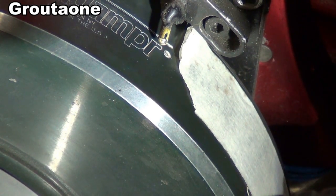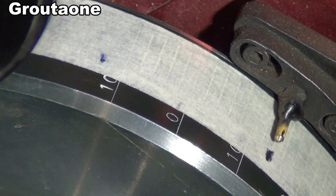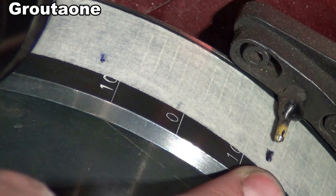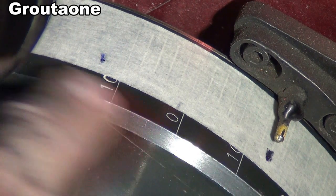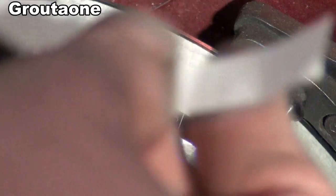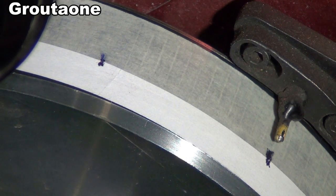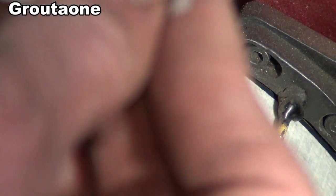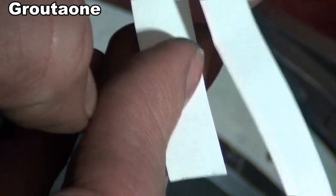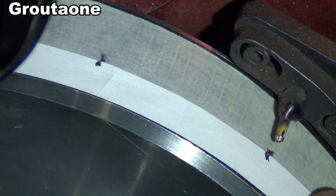Now I want to rotate the engine all the way around the other way and let that piston come to the stop again. I'm almost all the way around, coming up to it now - right there. I rechecked that these marks are accurate and the piston really came to a stop at these marks. Two marks, and the middle is going to be top dead center. So I've taken a piece of paper, transferred the marks from the tape to the paper, then I fold it in half and line up the marks - where I folded it is true top dead center.